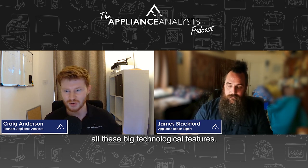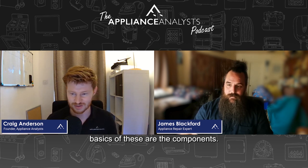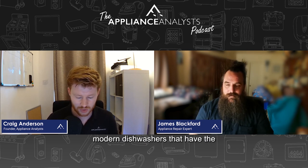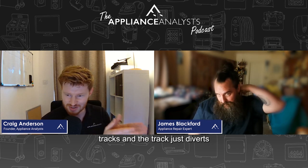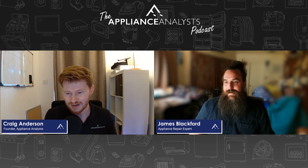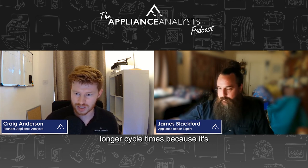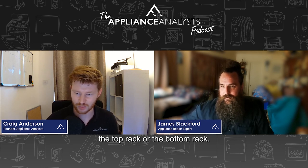Yeah, it's easy to be intimidated when you look at the marketing of higher end appliances and see all these big technological features, but it's great to break it down back to the basics of these are the components. They all do the same thing at the end of the day. I think you were saying with modern dishwashers that have the actuator, I'm picturing it as when you see train tracks and the track just diverts the train this way or the other. I guess it's the same with the water. You're saying the more modern ones, I guess most have that nowadays, but that's what's causing much longer cycle times because it's only going one rack, like the top rack or the bottom rack.